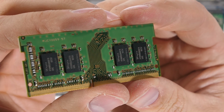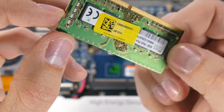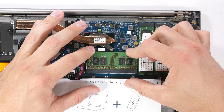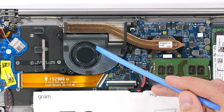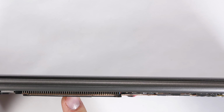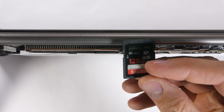The RAM is also removable and upgradable. This 8GB stick doubles, giving us 16GB of DDR4 RAM, making it a solid laptop for 2018. Thermal-wise, over top of the i7 processor, we have a massive copper heat pipe and a fan cooling off the tail end. Having only one fan is part of what makes this laptop so thin. The whole laptop clocks in at 27 decibels under load, making it pretty quiet. For reference, a whisper or rustling leaves is right next door at 20 decibels.